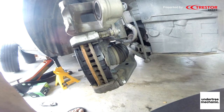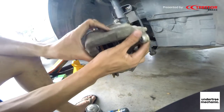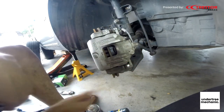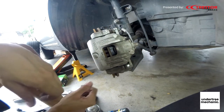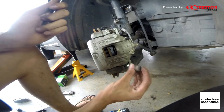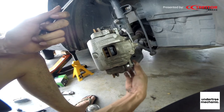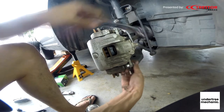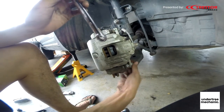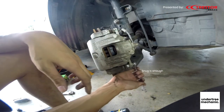We will do the top part when we screw the bottom part back in. There's enough space to go in, meaning our piston is compressed as much as possible. Get the 14mm bolt back in — make sure it's aligned. There is no need to be very very tight; make sure it's hand tightened first.